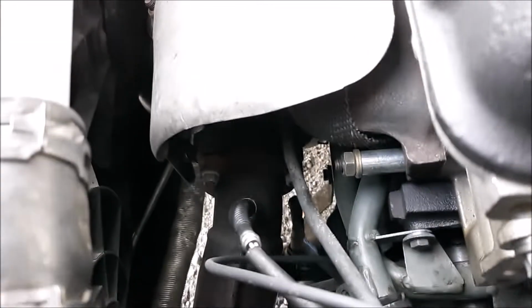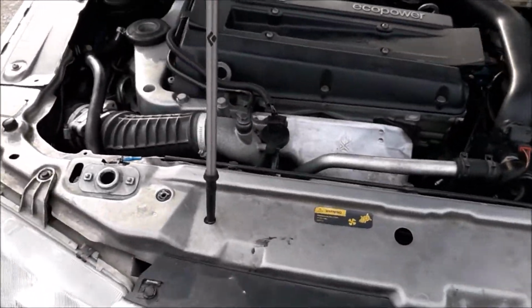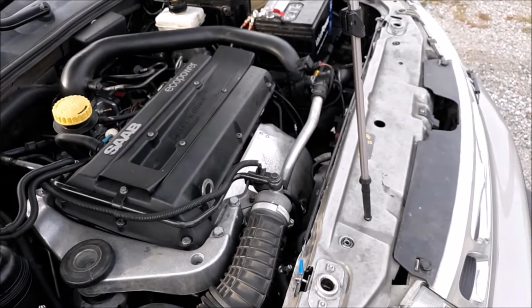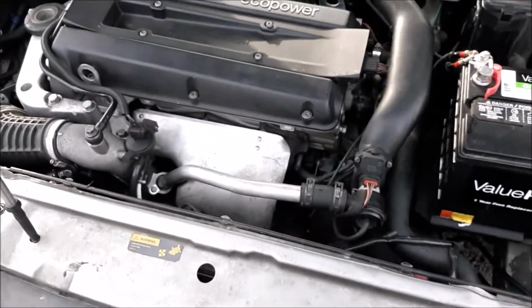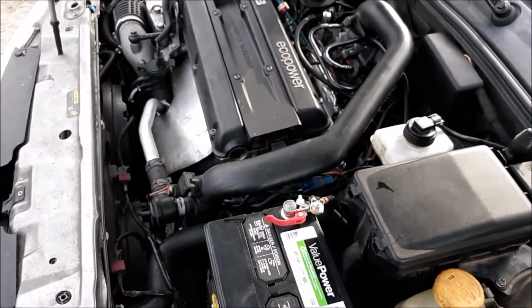And down there is the factory turbocharger, except actually it's not the factory turbocharger. This is a Chinese-built TD04 that bolts up exactly as it should. The stock turbo is what's called a TD04 15T. And the 15T is a designation for the size of the compressor. Some other things I'm missing. There might be a slight difference in the exhaust wheel. Anyways, this is a slightly upgraded size. And this engine now has about 800-900 miles on it, and it's running really well.